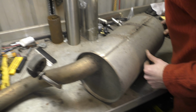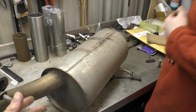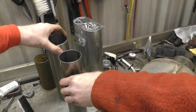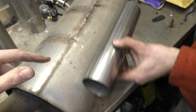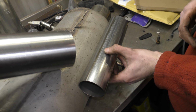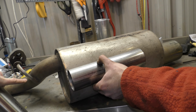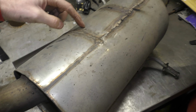So this car is going to get rolling roaded in 2 weeks, and I want to have this straight pipe on there before we start looking at the fueling, because I want to see what it's like with all this extra air. So we've got some assorted sizes of stock pipe: a 2 1/4, 2.5, and a 2.75, which we might have to join together with funny slopey angles in order to connect this high pipe at the back here with the outlet at the front.